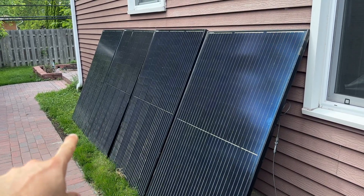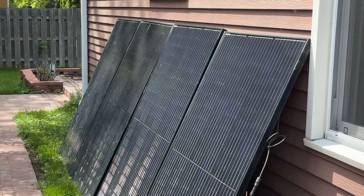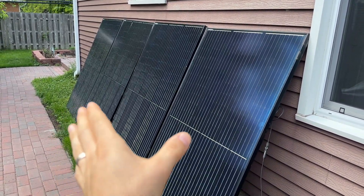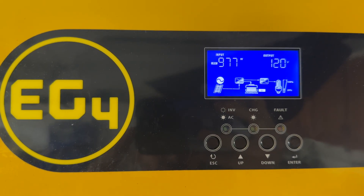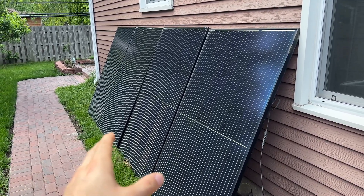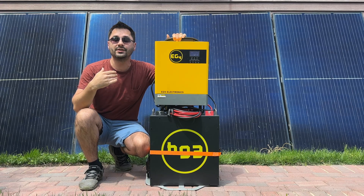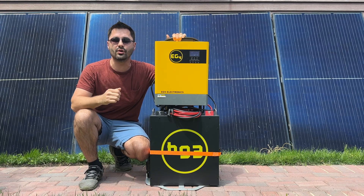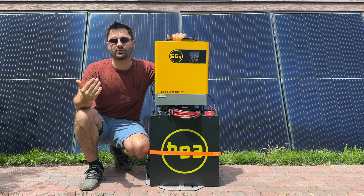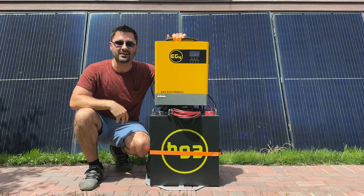A third of what we're putting into the car is coming from the sun. Even with those four panels just leaning against the house — not at the right angle — it would only take about a day to fully recharge this battery and have five kilowatt hours available. Each panel is 300 watts so it should be 1200 watts total, but a big tree is covering half of one panel and the sun is behind clouds. I'll mount them properly in the future to get the best results. I won't say this was easy — there's a lot to it and it's important to understand what you're doing for safety. I'm hoping to make this a series where I gradually build up the system to fully charge my i3 with solar.